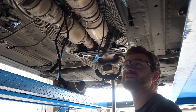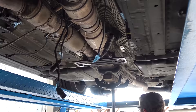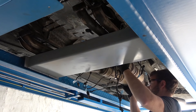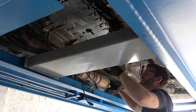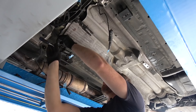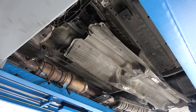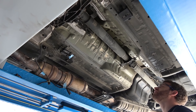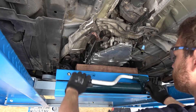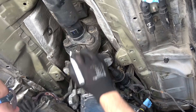I have a plan — let's see if it doesn't end up with the entire exhaust landing on my head. Time to lower it gingerly. Exhaust lowered — I think I can push it to the side. The four-post lift has its advantages; this would have been much harder on a two-post lift but here I was able to do everything on my own. Now I need to remove the heat shield. Here we have our prize. The flex disc — the hardy scheibe — that thing is toast. I support the gearbox in order to remove the cross member, marking the position of the drive shaft and loosening bolts.